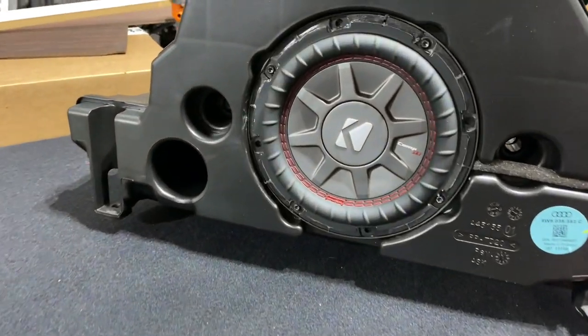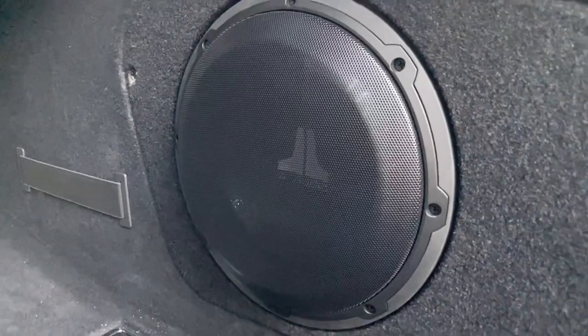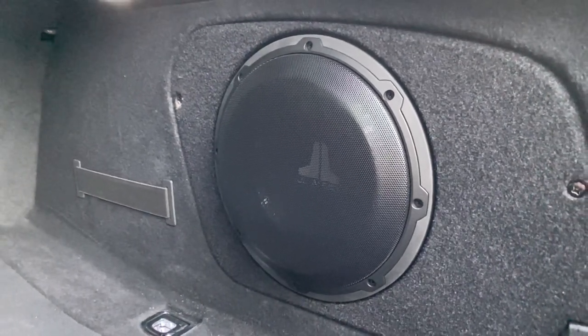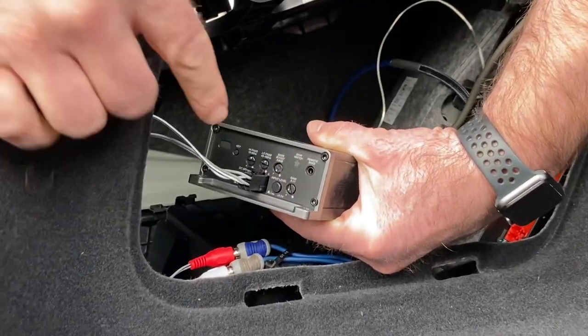First, I replaced the subwoofer. And that was an improvement, but even then, every once in a while, if you turned it up too loud, it would overdrive the amp and you'd have cutout. Then I looked at the Audi World forums and found a cool tutorial, and spoke with a guy named Bruce Miranda. He, as well as others, recommended this route. We went with a 10-inch JL subwoofer, a Bass Stealth box, and a Kicker Key amp up to 500 watts, and it's awesome. So why would you need any improvement beyond that?